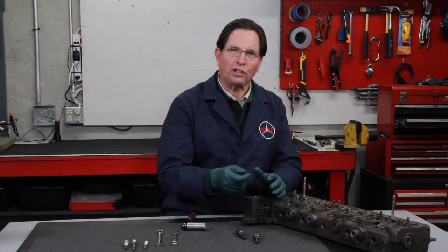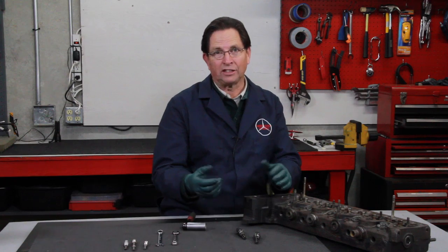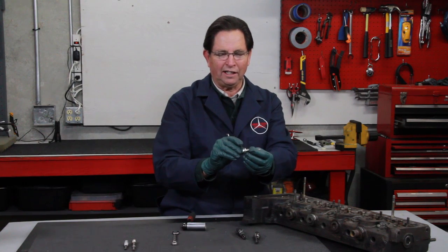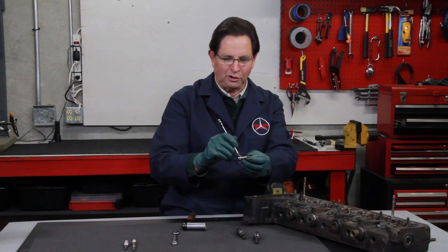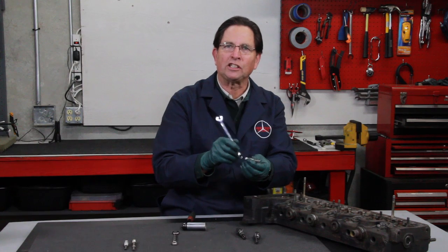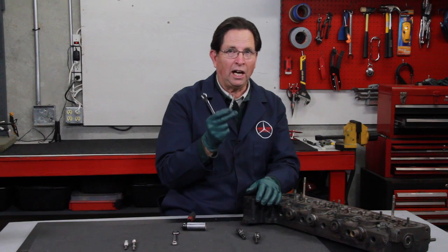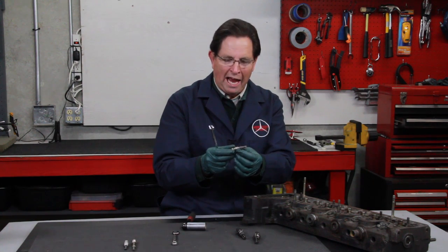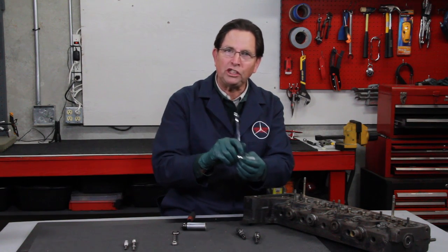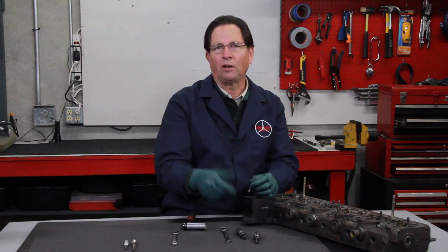You don't have to be too concerned as long as it's not excessive. One frustrating thing when you have a lot of carbon is trying to turn the reamer with a wrench — sometimes you can't get a socket on it and have to use a box end wrench. The problem is it goes in and slips off. What you need to be doing is pushing in while you're turning — that helps the cutting action and helps get the thread started. Particularly on the 617 turbo diesel engines, the carbon is so bad that you can't even get the first thread started, so pushing in while turning is essential, and that's very hard to do with a box end wrench that just falls off.